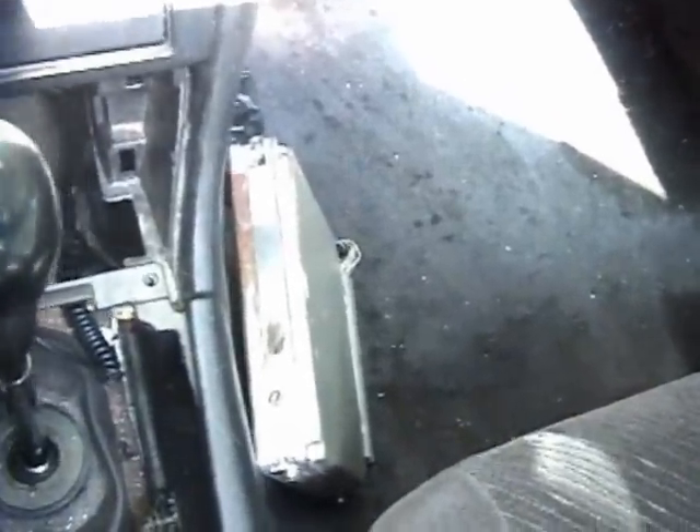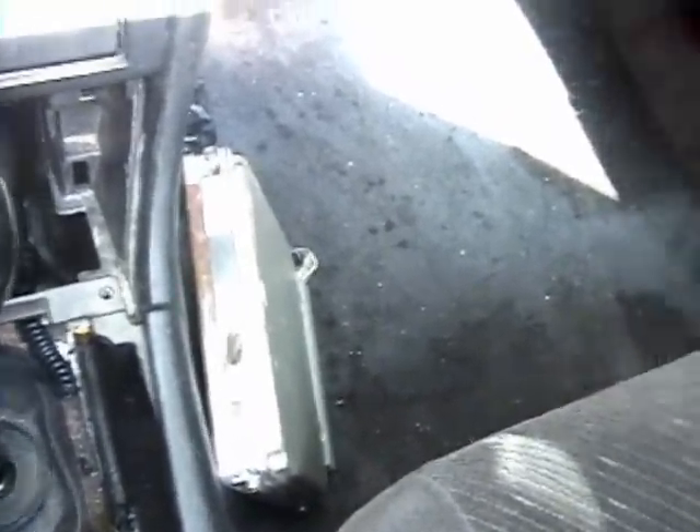When you start the car, your check engine light should now be off because you've cleared the codes. Note that emissions readiness monitors are also cleared — same as pulling the battery — so you'll have to drive around if you need to go through emissions. Also note: on the '99s, among other changes, the little screw on the ECU is going to be a tiny Phillips head, just like this one, and it's going to be a little further back.